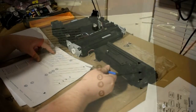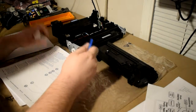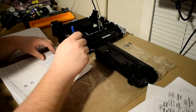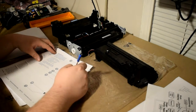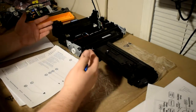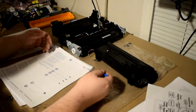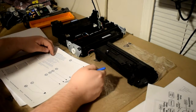This is a repetitive defect ruler. So basically, your first occurrence of the defect is here, and then each one of these lines represents the circumference of the roller and how far you'll get down the page. So say you have a defect here, that same defect occurs right there, print cartridge. And this happens to be on some HP printer because they all kind of look like this. You can get books of these for every printer, or most printers, or if you get your particular service manual, these will be inside. So again, you see, oh, defect is here, so well, I'm not on the right way. So you got a little smudge here, that same smudge shows up on 4.